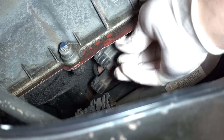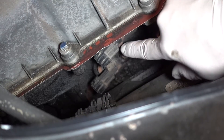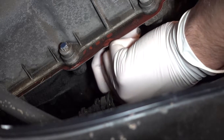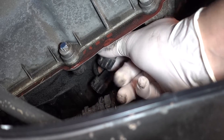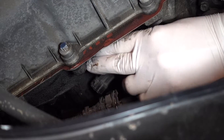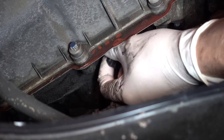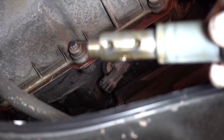You obviously want to be careful you don't lose the bolts, but also these have oil in them and you don't want to get burned, so be careful when taking these out. Taking them out could be a big pain, so you want to kind of twist it counterclockwise then try to pull it out — you can kind of just jimmy it out and move the wires out of the way. And there you go — there's the first solenoid taken out.